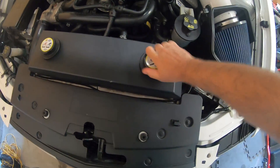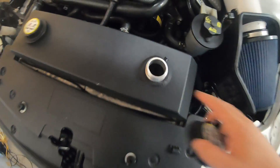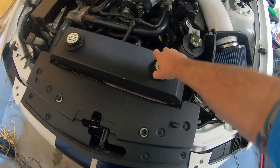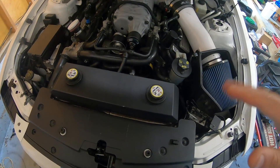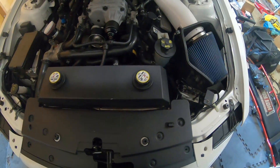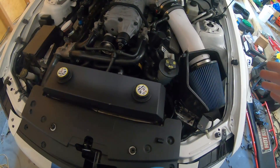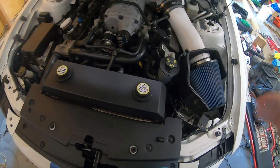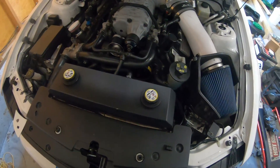Currently in my system, I am running a typical Ford Coolant — the gold coolant. I run predominantly Ford Gold Coolant with a little bit of water because I was trying out some ice in this tank last summer. Typically, what I see is about a 30 degree IAT-2, or IAT-1 to IAT-2 delta. When the car is first warming up, that IAT-1 and 2 is pretty damn close. But within about 15 to 20 minutes of driving, the IAT-2 starts soaring a little bit. That delta is pretty much always right around 25 to 35 degrees.